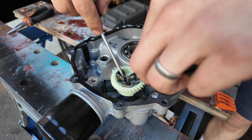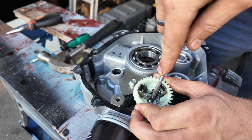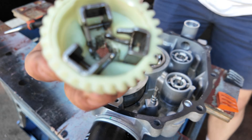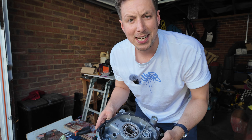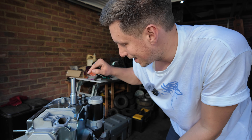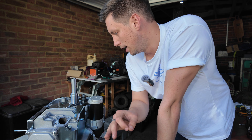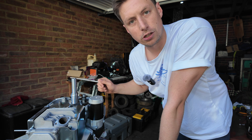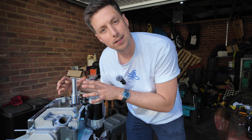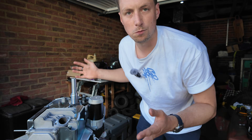Often you've got to be more brutal than you think on this - none of this stuff is any use to us for racing, so it's okay if you break it, you just don't want to damage the engine inside. Once the top cap comes off, there's a circlip ridge that holds everything in, then you've got the nylon piece of the governor. I got a screwdriver in and pulled the whole thing off. If you know a better way to do that, let me know in the comments. The final thing inside the engine is to get in and check the conrod bolts on the big end - just as a precaution to make sure they're torqued to the right setting, which I believe is 25 Newton-metres. I've had a good look - no swarf, nothing untoward inside here.